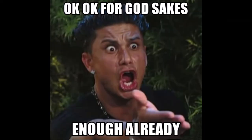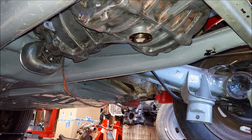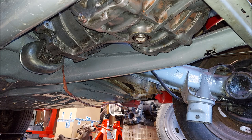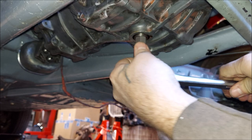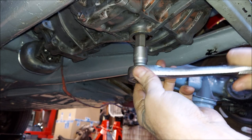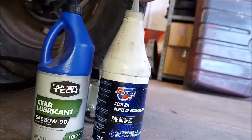One with the magnet goes in the drain plug. You can torque this to what the Bentley calls for. I can't remember and I'm not going to give you torque specs, because everybody has their own ideas about that. So you're just going to snug this up, find out the torque, and do it. Okay, we're going to move to the side.